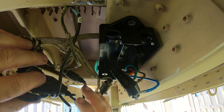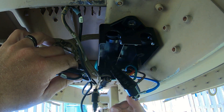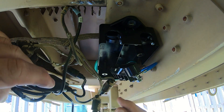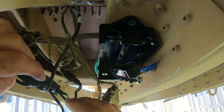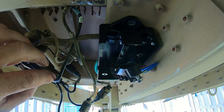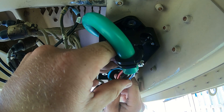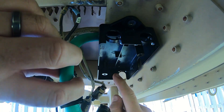After I got this all up, I went to hook my ground wire first — which was this first one — and then realized it wasn't going to reach all the way back to the white. I looked a little further in and realized that this can actually unclip from inside of here; you just kind of push to one side with your fingers. So I'm actually going to end up flopping this to the opposite side — kind of how I had it the first time — and now I can get this negative wire in. I've taken those screws out and I'm going to move this, and actually move all these to the other side so it still lays across that back side, out of the way a little bit more.